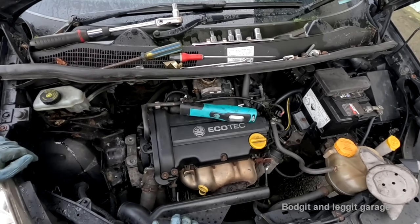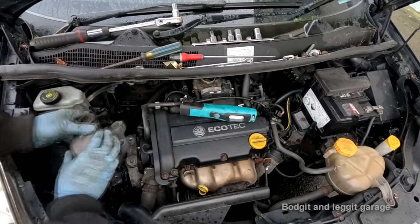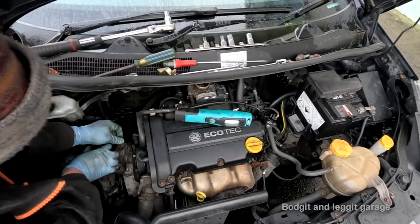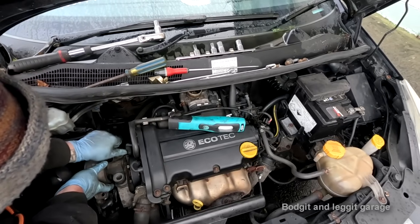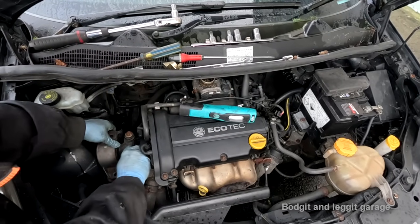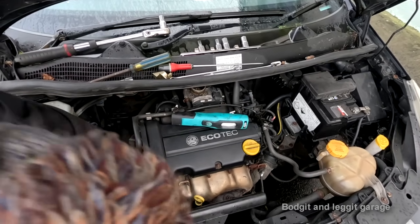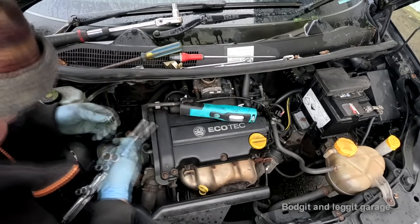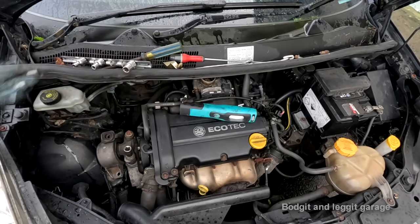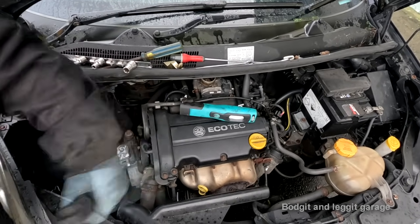I tell you, like I said, them tools that were broken turned out to be brilliant. Right. As you know from here, these threads are already damaged because I know I'm right, someone had a gap here and they put an air tool on it and they've screwed it up. So what you can do is, this is way too high now, but I also know that these threads are bad. It's not good. But I also know that I'm not putting any pressure on them. So if I screw them down now, where there's no pressure on them, I'm not lifting the engine up to meet it.